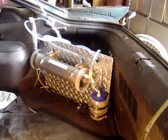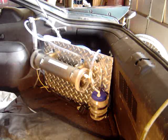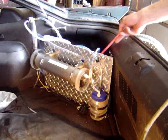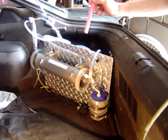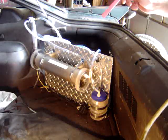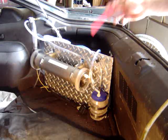Here's the latest design I've been working with for the HHO generator. I'm going with the horizontal style simply because it seems to be making gas faster — the gas can escape the water quicker because it has a shorter distance to travel. Because of the horizontal style I had to go with a gas line coming out of both ends of the tube to prevent water sloshing into the lines as you're going around turns, which would push it over to the bubbler and you'd lose your fuel.